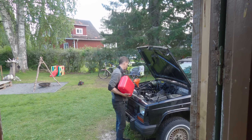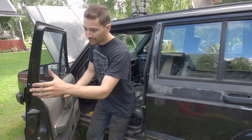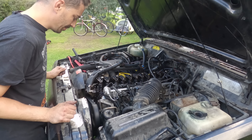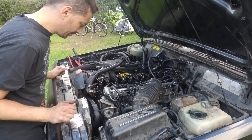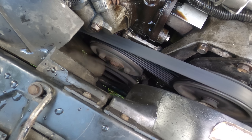So I finished hooking this all up and it isn't looking that pretty, but this is what I've got going on so far. You can see where I've kind of eliminated that climate control valve. I don't want to do anything permanent at the moment because I want to buy some new hoses and get a nice clean system put together. But for the time being I'm going to put some water in, just run it through, clean the system out. This isn't the easiest system to fill — and by the way, I am using a brand new jerry can so there's no fuel in this. At least with open lines I can burp the system a little bit easier. And it still looks like there's quite a lot of glycol actually in the radiator too, so at least there's some coolant in the system and it's not just water.